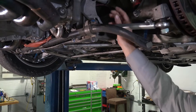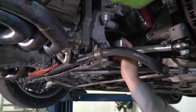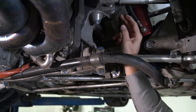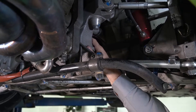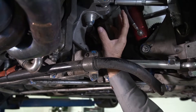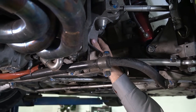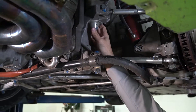The rubber is right here — this is where the lower piece mounts. The rubber is the joint between the subframe itself and the chassis of the car, which is great for a road car because it takes away harshness. But for a track car or race car, having any rubber here means your suspension alignment and the feel of the car will change as you go through corners and down the straights. So you want as little rubber here as possible.